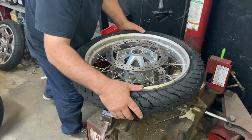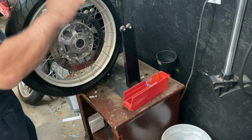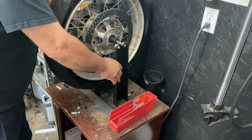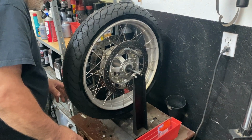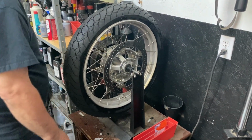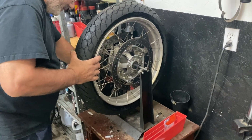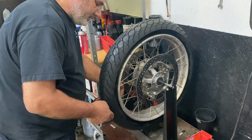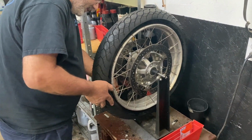So next we got to balance it. The first thing George is going to do, once he gets it set up, is scrape off the old weights. Nah, I'm cheap. I'm going to see if it balances with them. That's a good idea. With the tire pressure monitor in there, these wheels may take more weight than you'd think. That's why there's 8, 9, 10, 11 blocks on there right now. Because it has a tire pressure monitor, they almost always go back completely opposite the sensor, so there's no point in taking them all off. Just take a few off, see what happens, put a few on.